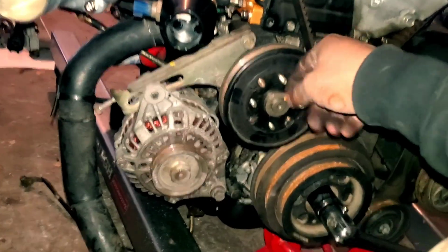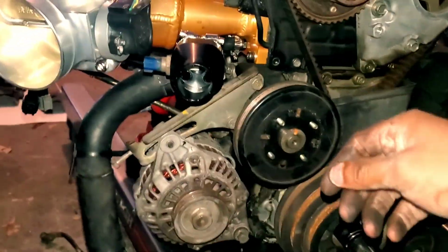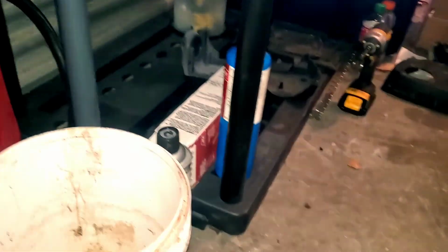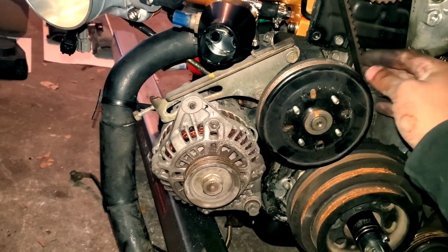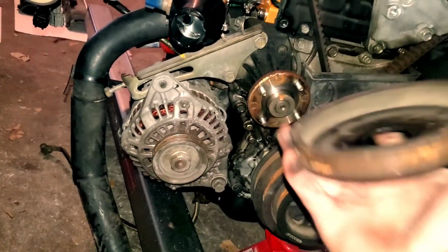So for this one, it was those 4 bolts that were holding this in on the little fan thing, the 410. There it is. The 4 10mm nuts that were holding that in. This just was being a pain to come off. But once you undo those, I had to pry it off in a couple areas, same old screwdriver and hammer type of deal. Then the actual pulley was left on here. Pretty sure that just slides off. I'm gonna put that over here with it.